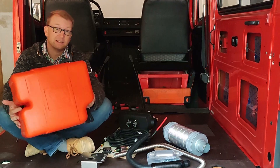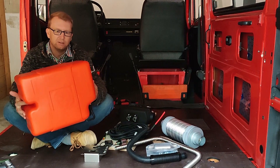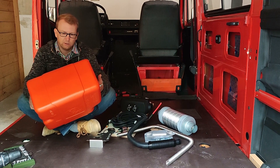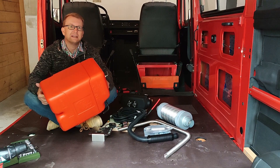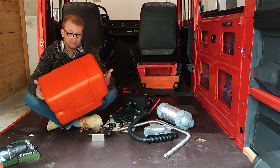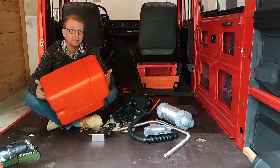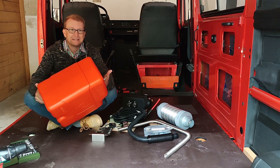Having a diesel heater with an extra tank gives peace of mind because you never risk draining your main tank and getting stranded — that's a big advantage if you travel in remote areas where you do not find a gas station just around the corner. Heating with diesel is more economical than heating with petrol because diesel in most countries is cheaper, and with the extra tank you even have the possibility in Germany to use domestic fuel oil instead of diesel, which is again 50% cheaper because it is much less taxed.